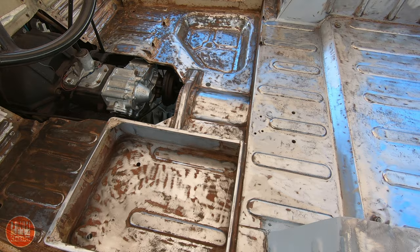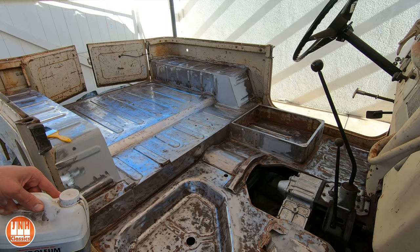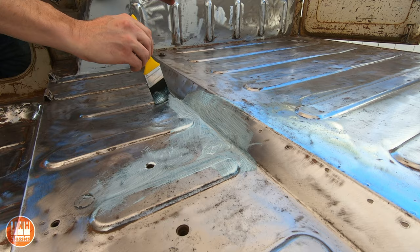We've got pretty much all the paint stripped off. The red areas you see are not actually rust - they used a red primer below the paint, so a lot of that is just paint you're seeing, not actual rust. I did go ahead and go over the whole thing with this rust reformer, brushing it over the entire surface just to make sure if there was any rust I didn't get to, this should hopefully treat it.